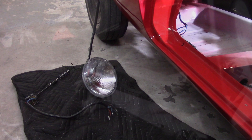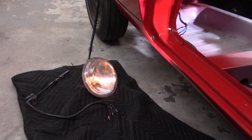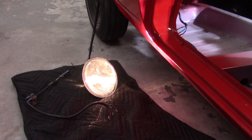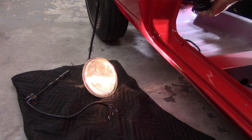I slid that back together, put the steering column back, and hooked up the power supply to see what happens. Parking lamps work, headlights work, and the flash works — just barely, since the power supply can only put out about six volts. Turning the brights on fully at the foot switch — all right, so that works.